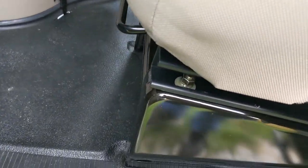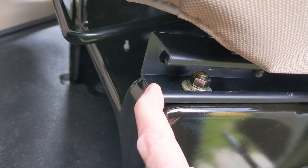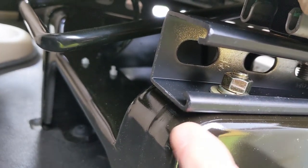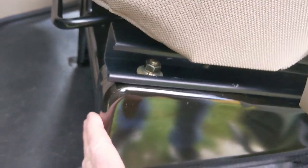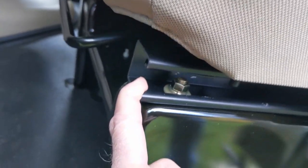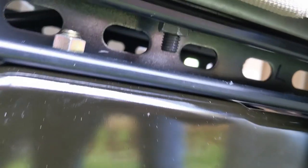The posts that I found used a product — these rails — it's called Unistrut. They're typically used to hang machinery from a ceiling or something like that. You can see the slots here. I bought a five-foot length of that on Amazon, and I measured this frame that the seat's mounted on, front to back, and cut me two pieces of this Unistrut about the same length as this frame — one for this side and one for the other side. Then I looked at the size of the bolts that Ford had used, and you can see them right here.